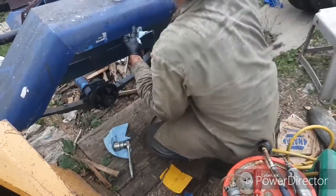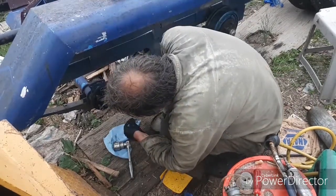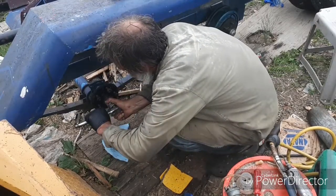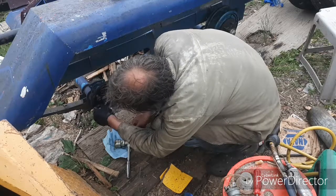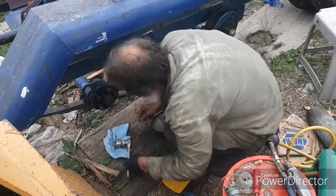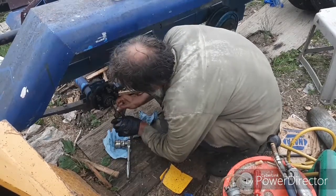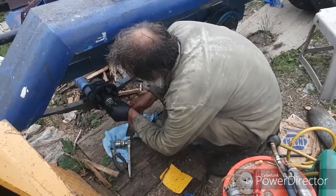Okay. Let me find the cotter key from our assortment. Get the right length. We try and find our quarter turn. It'd be one just to the next nut nodule there. Right there. Make sure the long side of the cotter key is facing out. Push it through. Grab your side cutters. Bend it over. Tap it down flat. Take a nice clean cap. Put it on there.